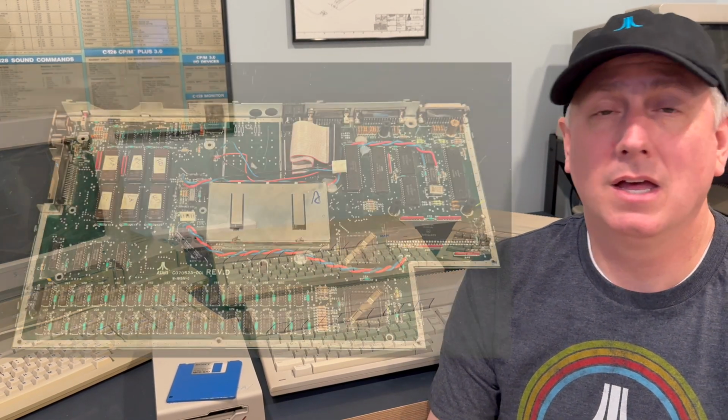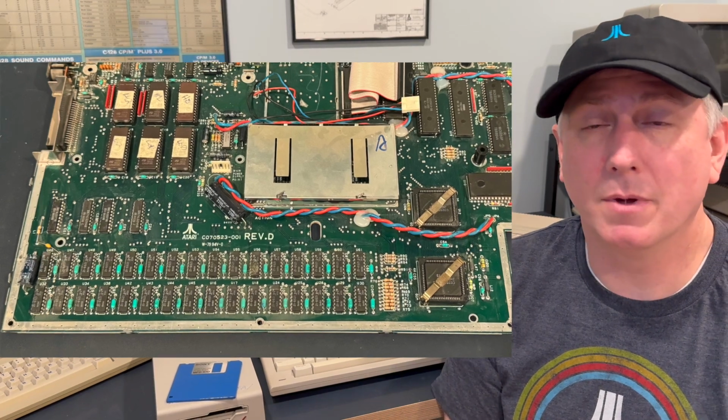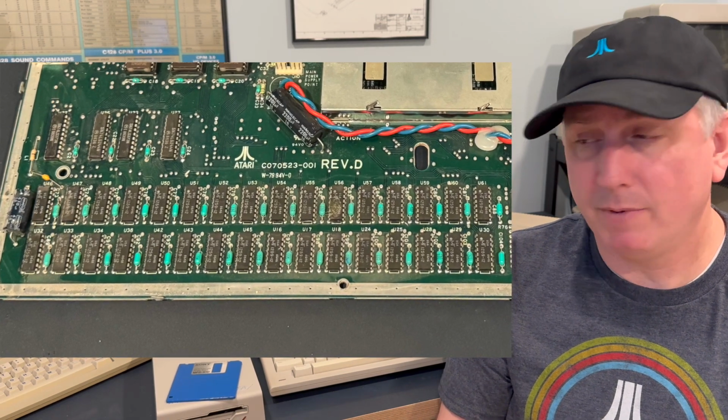All right, after the CPU, the next thing to consider is the amount of RAM in these computers. The Atari STs, in general, run anywhere from half a megabyte up to 4 megabytes of RAM. Yes, there was the Atari 260 ST that may have had a quarter of a megabyte of RAM, 256K. I think most of them actually were upgraded to at least half a meg, 512K, or even 1 megabyte of RAM. But that said, the vast majority of Atari STs you're going to run into have half a megabyte to 4 megabytes. And in reality, those that come stock are the vast majority, the 520 STs and 1040 STs, which have half a megabyte and 1 megabyte correspondingly.